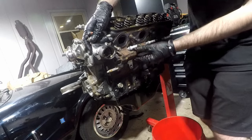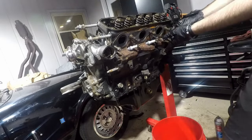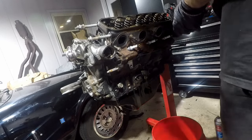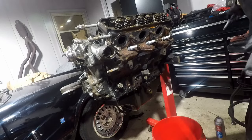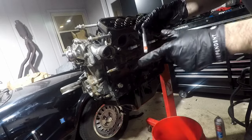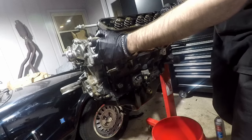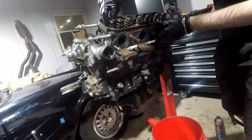Dowels are lined up, we're good to go. Got a set of new head bolts that come with sealant. I'm going to put some extra sealant on, but first getting some bolts in to make sure the head is secure and isn't going anywhere.